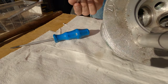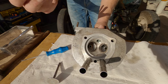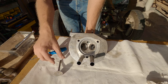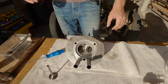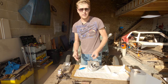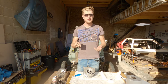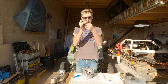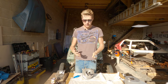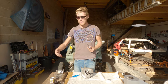Like I said, there is a test where you put your valves in, and then you put oil in, and you pump up the pressure, and you put a piece of transparent plastic over the top and watch to see if the pressure drops and see if any oil leaks out. We're not going to do that here because I don't have the kit, but we don't really need to. This will be more than good enough, because if you do it right and you do it enough, then it will seal. So that's just kind of a check. And it's not like we don't have a ton of valve and a ton of valve seat to play with. If you had race valves where they're as thin as they can possibly be, and you want to make them seal without overlapping them, because you can obviously lap a valve too much if it's a racing valve and it's super, super thin and super, super strong, you can overdo it, and that then would mess with your flow and stuff like that. On this engine, that's not really an issue. So testing it in that manner just isn't really necessary, because we can just lap it a little bit more and it'll make sure it seals.